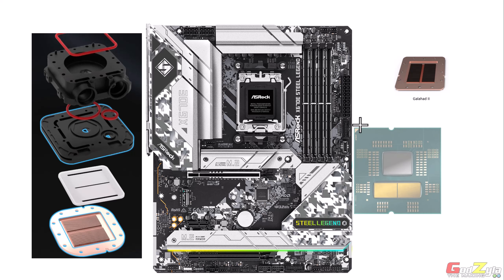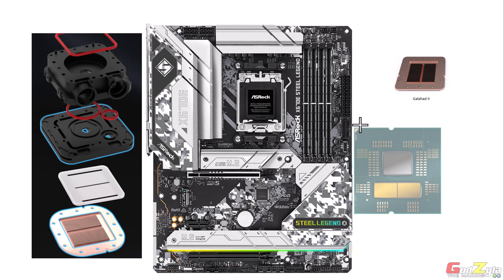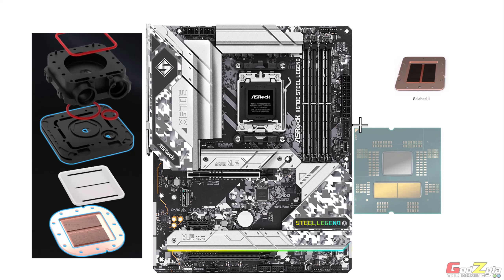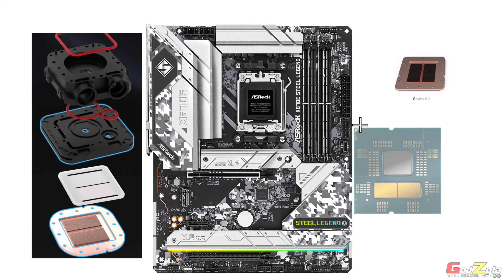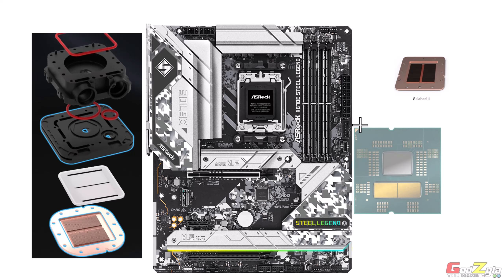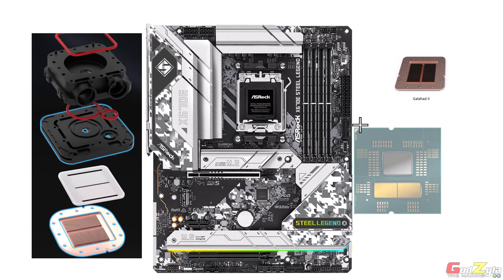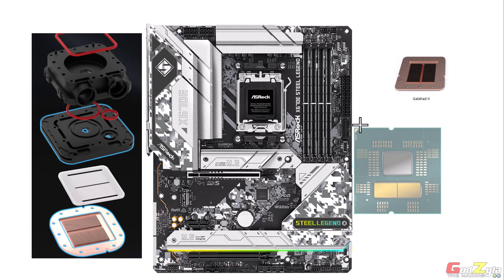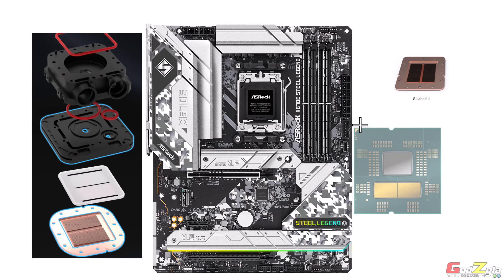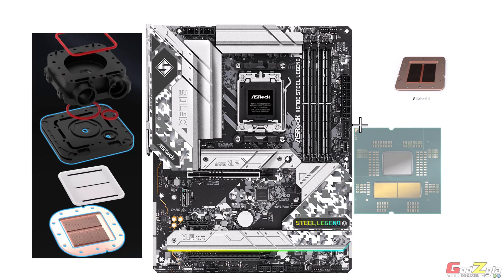The Trinity Performance accessories are the same as the Trinity except for the mounting brackets — both Intel and AMD brackets come as two-piece designs instead of one piece. Clip both pieces onto each end of the pump, ensuring the hose faces the correct direction.